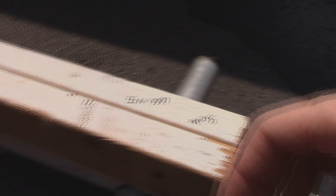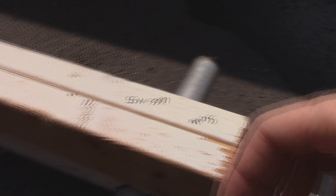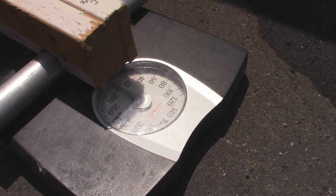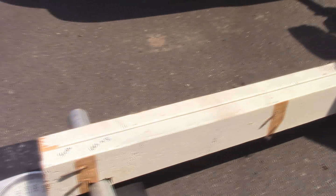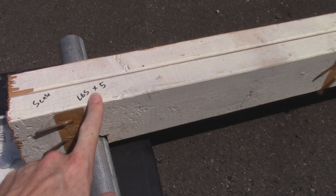From that pipe all the way down to this pipe it's five feet. Here I have the bathroom scale — just make sure you zero the scale after everything is sitting on it so it reads zero pounds. Once I take the tongue jack and lower it to take all the weight off of the ball, take the number on the scale, multiply it by five, and it gives you your tongue weight. Let's try it out.